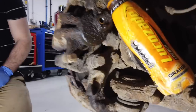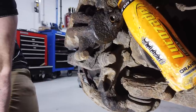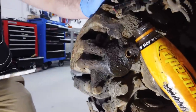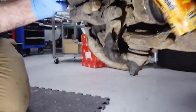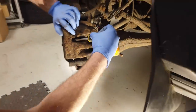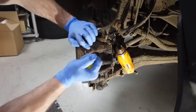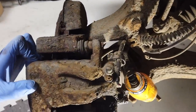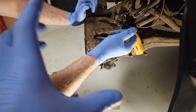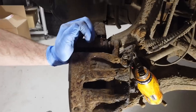I'm under the car now - I get all the best jobs. What we're going to try and do now is take the caliper off. But before we take the caliper off, grab that screwdriver out the disc and jam it in behind there - like that - and then lever forward. You should feel it sort of move. You can see these bellows as you do that. What you've done is you've loosened the grip of the brake pad - that's perfect. When we've got the bolts out that caliper will fall off easy, otherwise we'd be fighting it off.